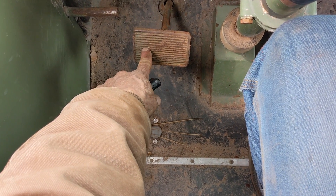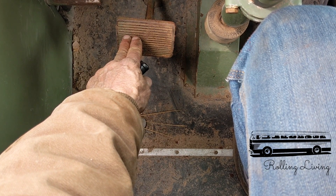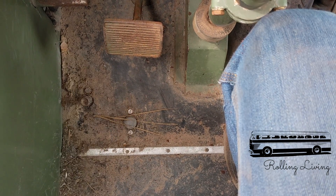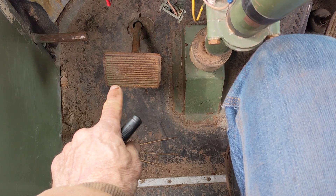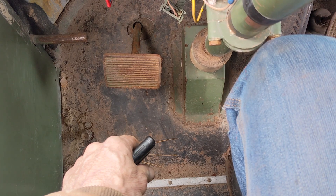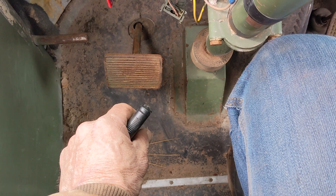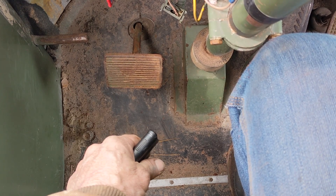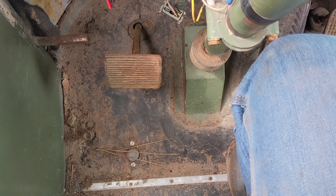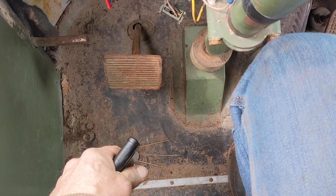I had no free travel on this, and the clutch was slipping just a little bit. So what I'm going to do is crawl under the bus after I air it up and then block it up. That's really important — if you are under a bus with air suspension, never get under it in a way where if one of those airbags blows or deflates, you could get crushed. So I aired up the bus, which raised up the back about nine inches, and then blocked it up back there. So if it deflates while I'm under there, I won't get hurt.